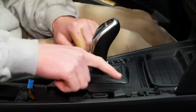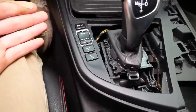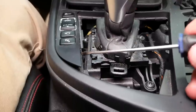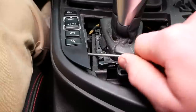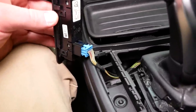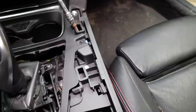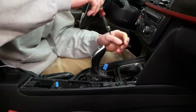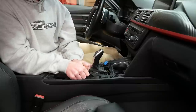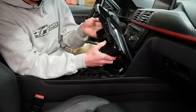Next, using a plastic pry tool, we'll pry up the gearshift trim. Then, using a plastic pry tool or a small screwdriver, we'll pry up this control panel. First, pry up the plastic piece on the back and carefully use a small screwdriver to release a clip on the back and one in the front. Pull the unit out and disconnect the blue wire underneath. We'll now use a T20 Torx bit to remove one screw located here and another one up front. We can then pry up on this center assembly starting in the back corner, pop it up and out of place, disconnect the electrical connections underneath, and remove the assembly.